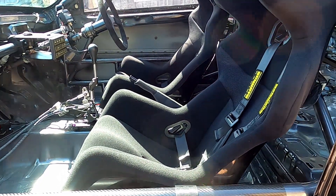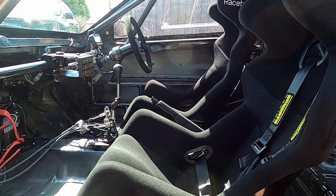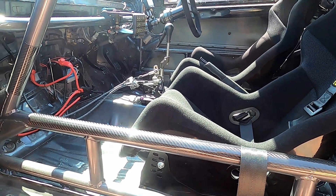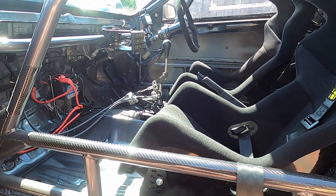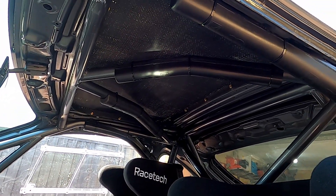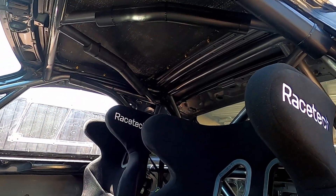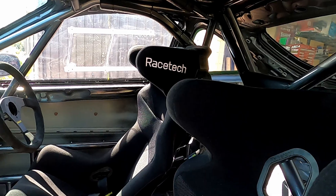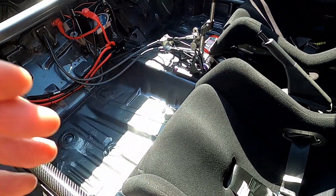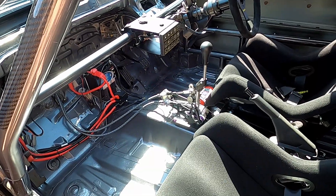Inside the car we've now got a passenger seat and harnesses all around. My co-driver Adrian Burney popped over the other night and we got all those set up and adjusted for the proper lengths and angles, so the interior is fully ready to go. I also added a bunch of little grommets and plugs to try and seal up the interior from all the holes of the stuff I've removed along the way — no doubt a little bit of water will still get in if it's a wet event, but not too much. Also put in some SFI rated roll cage padding, which is a requirement here in Australia anywhere that your head can touch — two pieces just along the side and along the V at the top. I am waiting for some foot boxes: a carbon fibre navigator's footrest which kind of boxes in the footwell, and for the driver just a flat plate that goes under the pedals. Once those arrive that'll clean things up and stop people's legs being able to touch all my electronics.